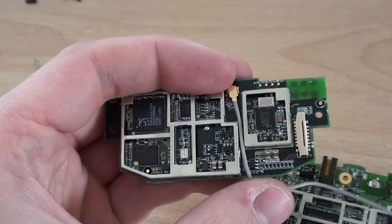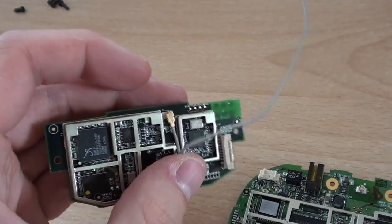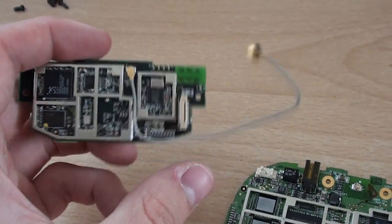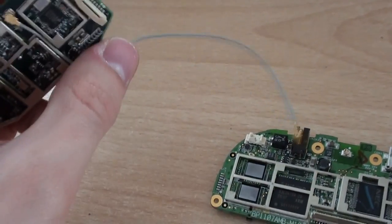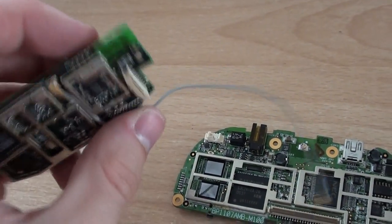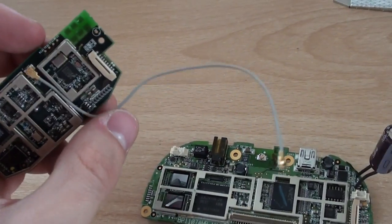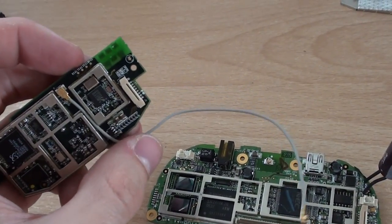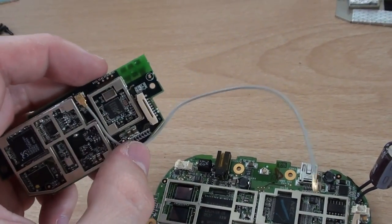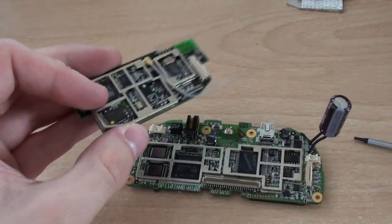Overall it's a very well designed board, but I'm still not sure entirely what this coax is for — because if all of the GPS signals are received and processed on this dedicated board, I can't see why the main processor would need a direct connection to the GPS antenna. Maybe it was an additional extra, or perhaps it was left in case a future firmware update required the main processor to have that direct connection. Well, this is definitely the end of the video — thanks for watching and hopefully I'll have another video up soon.